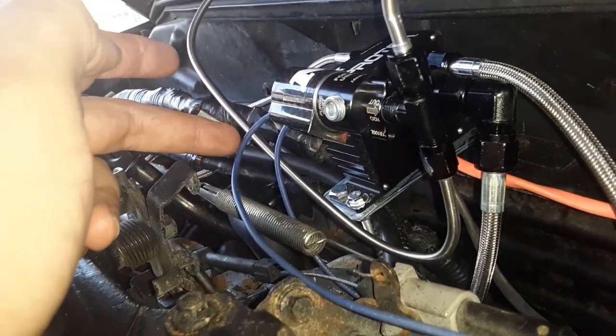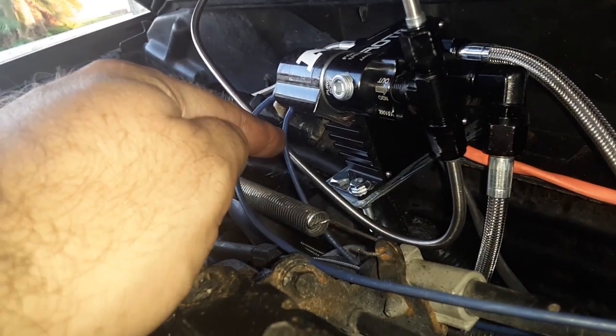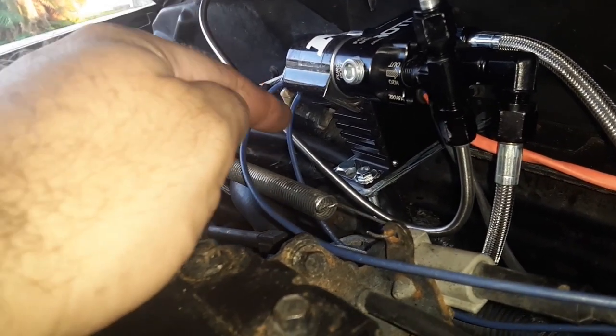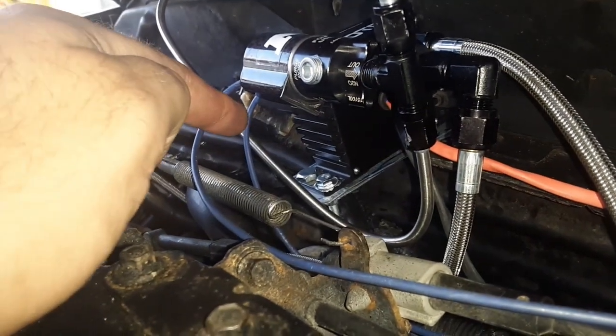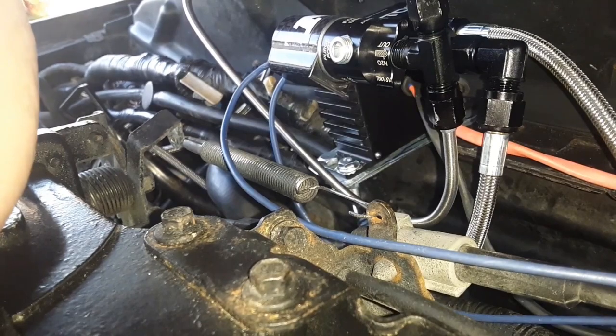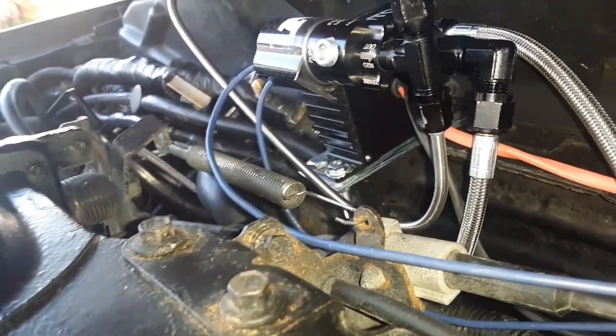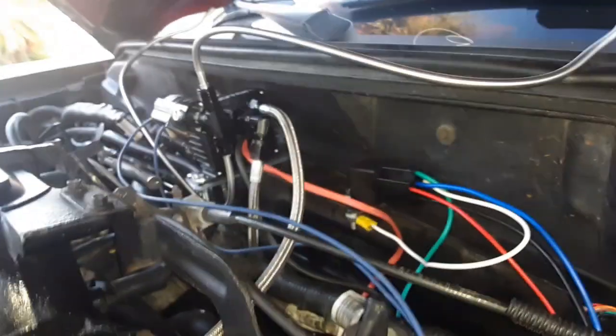It also doesn't matter how it's activated. If you want this to go to the battery and the switch to turn it on by ground, you can do that, or you can run this to ground and power. It doesn't matter. Okay, so there's no polarity, there's no on and off with power or ground. Either way, however you want to run it, feel free.